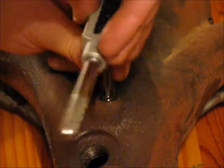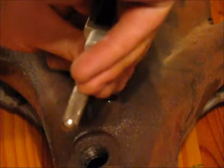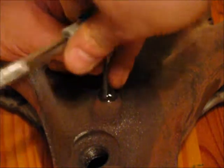It's very important that you're going to go flush with the hole, or else your threads are going to come out uneven. Pretty much what you're going to do is once you get it seated in there, you're going to give it a quarter turn and a quarter turn backwards — a quarter turn forward and a quarter turn backwards. Just keep doing that.